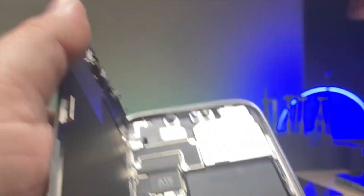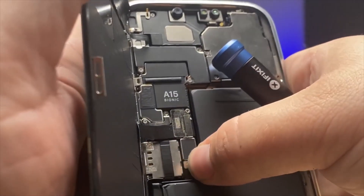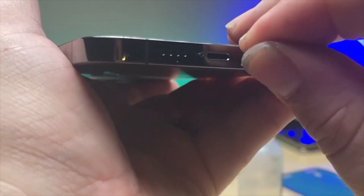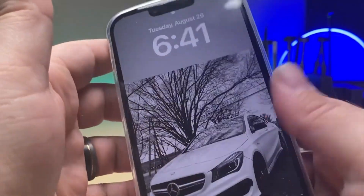Switch over to our Phillips and put back the two screws. Connect up our battery, line up the bracket, and put in three screws. Install the top of the screen and put in the bottom two screws. Turn it on — and there we go, all ready to go. The key to making this a quick and successful repair is organization — keeping each screw organized as they all have their own specific places. All in all, this should definitely take you less than an hour, but plan for an hour because there's always going to be interruptions. Leave a comment below if there's something you'd like to see in a future video. Thanks a ton for watching — we'll see you in the next video.